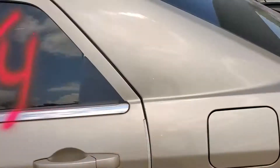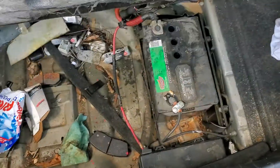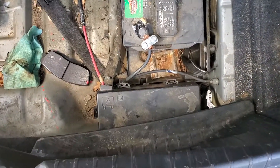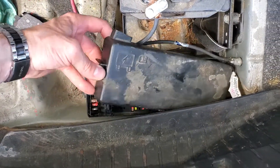So we're gonna get into the trunk. Right by the battery is where you'll find the cover for the fuse box. You remove it by pushing in on this tab here, and it will hinge up.